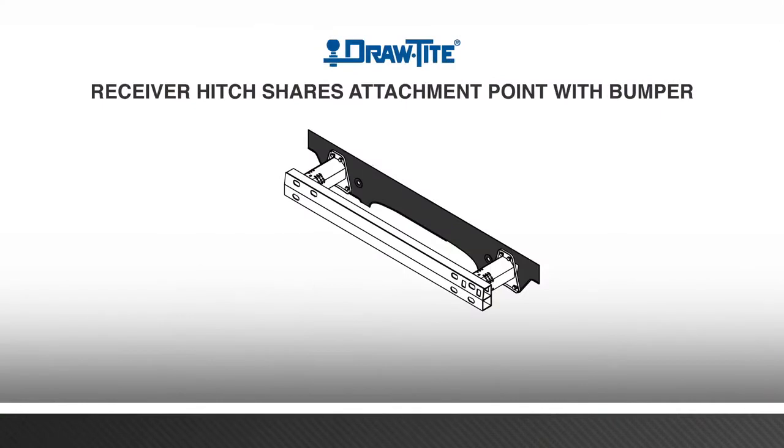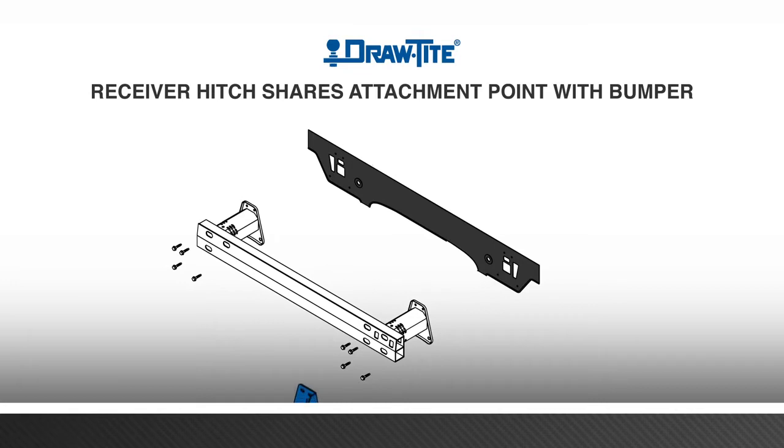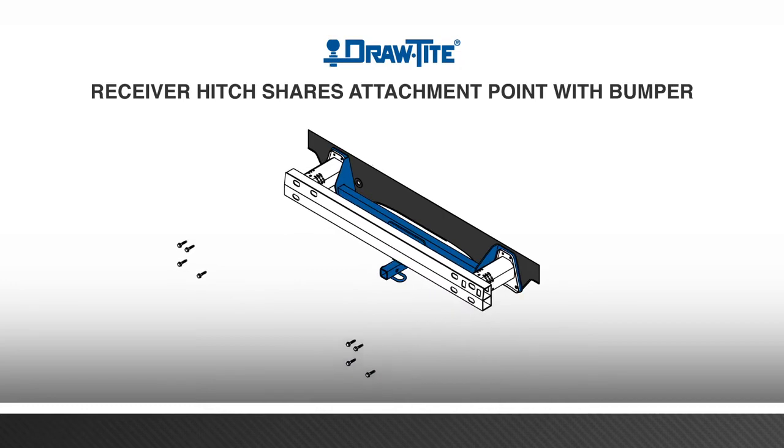Some vehicles require the hitch to share an attachment point with the bumper of the vehicle. In these situations, loosen the hardware to remove the vehicle's bumper, then install the hitch by aligning its holes to the attachment points in the vehicle's end panel. Once the hitch is placed, reinstall the bumper beam so that it sandwiches the hitch against the bumper end panel